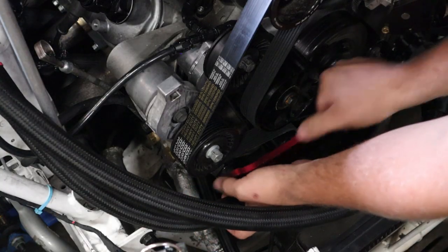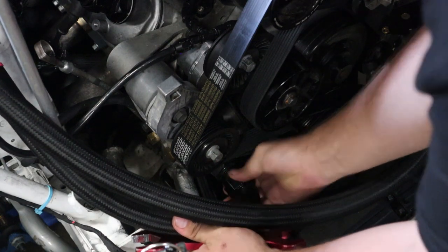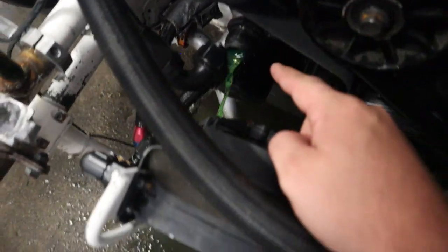Once it's drained, I'm going to take a vacuum and try to suck all of the fluid out. So first thing I'm going to do is take this line off and let it come out. Now we do have a lot of water in our system, so it's probably going to be draining for a little while. Everything's green in the system — we do not use coolant, it is water only. When we were dealing with our cooling issues after New Jersey, we bought this dye that goes through the water system. It makes everything green, but when you take a black light to it, you can find all your leaks. Turns out we were fine and there weren't any leaks, but we put it in as a precautionary thing. The dumb thing is we've drained this system like four times and everything is still green — just a little bit of green makes everything green.